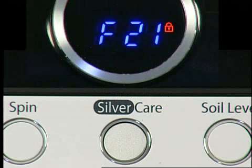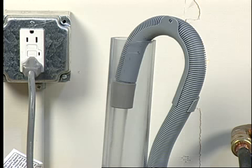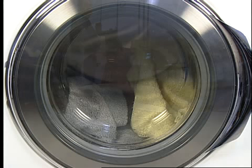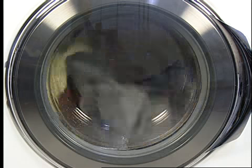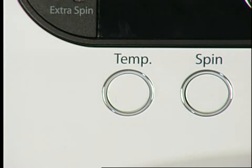A quick cycle can be activated when in this mode. While in the service mode, press Temp to start the cycle. If there's water in the tub, it will begin by pumping out. The washer will fill and start a cycle. The RPMs will display as the basket tumbles. The washer will complete a cycle in about 20 minutes. As the cycle advances, you can skip a stage of the cycle by pressing the Temp key again.